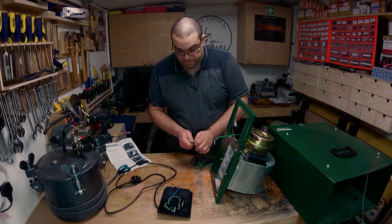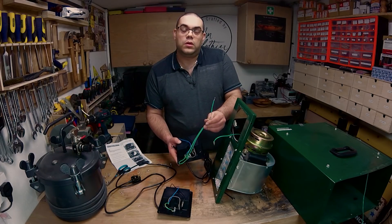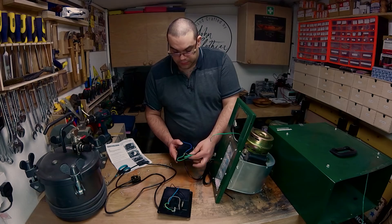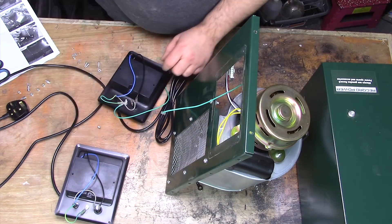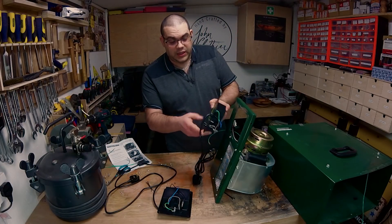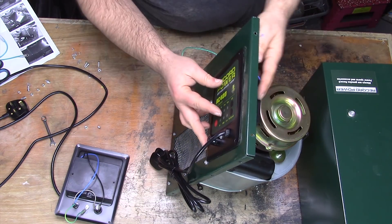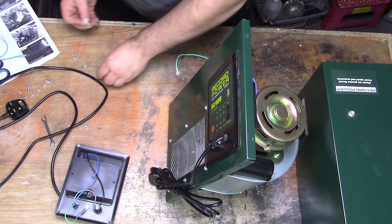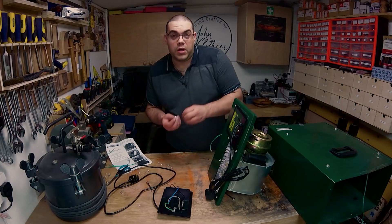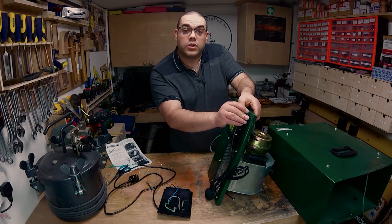Of course we're not going to throw those screws away — you never know when they might come in handy. Now the new panel comes with the two earth leads for the motor and for the housing, and because I've left those I'm going to just undo the bolt this end and remove them. Making sure not to trap any wires and making sure that the control panel is facing around the correct way, you can pop that in. Then it's just a case of screwing them back in. I'd recommend doing them up loosely with your fingers to start with, go around and get them all lined up, and then go back and tighten them all up.